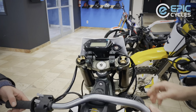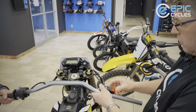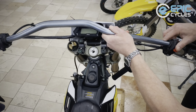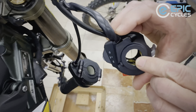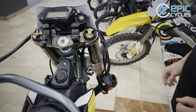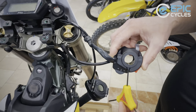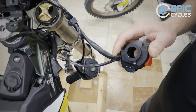The bar, because this cable has only so much length, I'm going to put the controls on first, making sure they're in the right location. You can see we have letters here — if you put it on this way it's going to be upside down, and you're going to have to start your process all over again. We've got something sticking — the bolt is just sticking out a little bit. I'm going to use a 2.5mm Allen key to recess that bolt flush with the ring. Now I can slip this on — making sure it's oriented correctly.